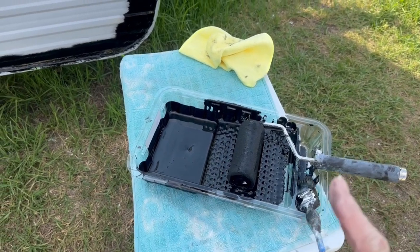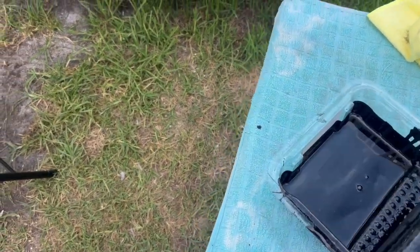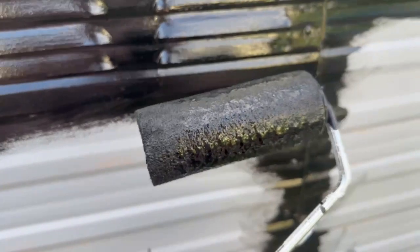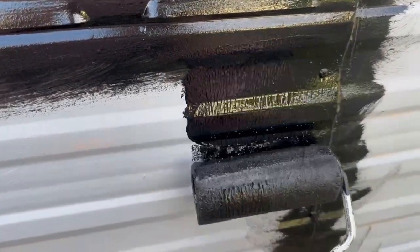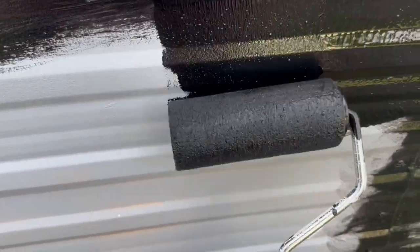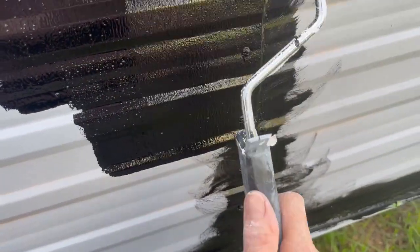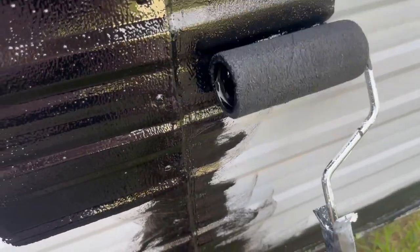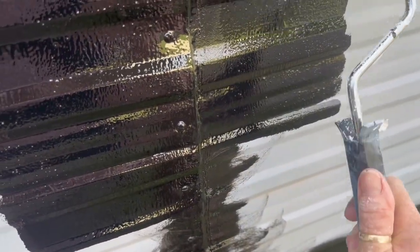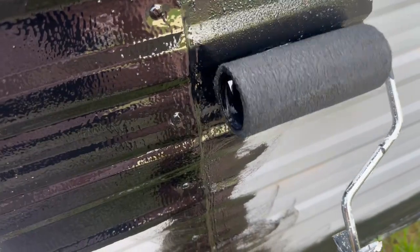I swapped from the big tray to the smaller tray - it can still go on a pole and it's much easier. The nap on the Goldilocks roller is quite small - still recommended for gloss paints but not too long a nap, and certainly not foam. The other tip: you need to go slowly. Roll it over all those little creases - this small roller really helps with the crevices and undulating surface of the caravan. If you go too fast you get bubbles, so slow down.